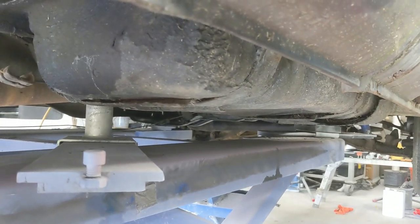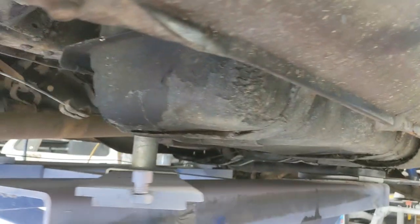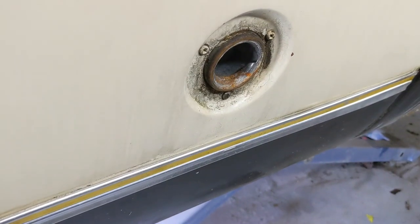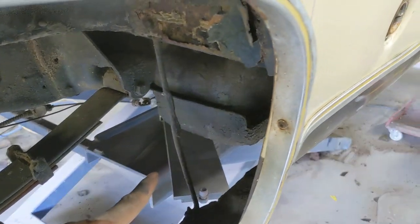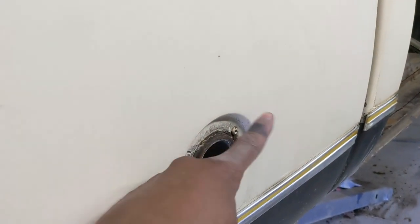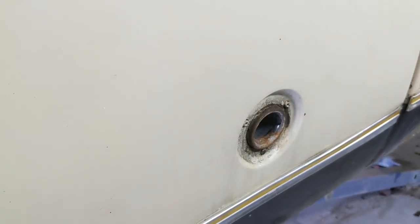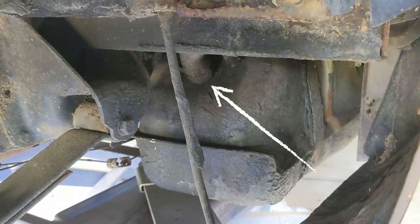It's going to be kind of challenging to show you guys where everything is - there's a bolt way up on top of the tank and way down there on top of the strap. I'll try to show you after I get it out because it's hard to show before. Also, if you don't want to remove the fuel tank, you can come right here, take these screws loose - that goes to the inside. Take it loose and push it through that way, which saves you from fighting with that clamp that's right down in there, because that clamp can be a nightmare.